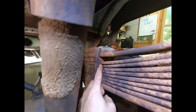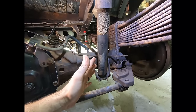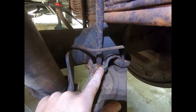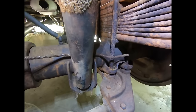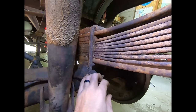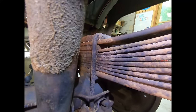But if you look at this leaf right here, it's completely broken off. And that happens to be the main leaf that runs up to the eyelet and connects this rear axle to the truck. Now it's not an immediate failure thing unless you were to hit a huge pothole and then break off these almost-rusted-in-half U-bolts. GM in their infinite wisdom put them down in these pockets that hold dirt, salt, and debris. So not good. These have rust jacked - that's when rust gets in between the leaves, expands and puts so much pressure on them that it just breaks them. Then the rust messes with the surface of the spring and over time those surface imperfections cause cracks to start.